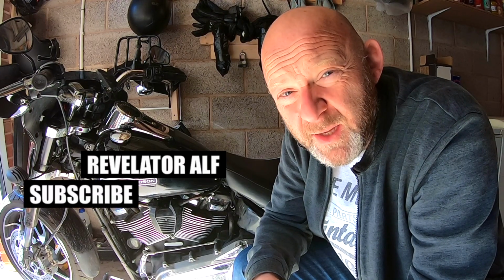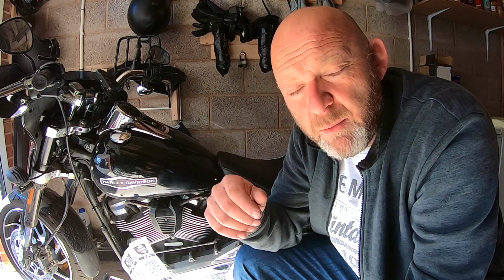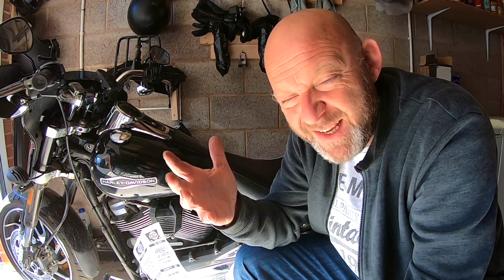So this video is all about problem solving and issues potentially with the battery, but it could be something else. In a previous video I talked about this stuttering start that I had with the bike, or that I still have with the bike. I thought that I had solved it by tightening up the battery terminal leads cables, and it did actually fix it, and everything I discussed in that video still holds true.